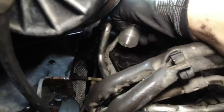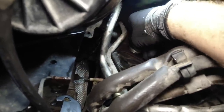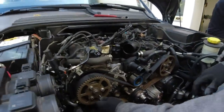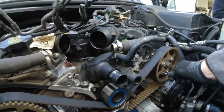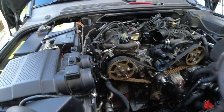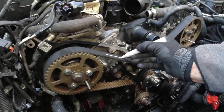This is a tool I made — it now fits nicely and locks the flywheel in place. Got the camshaft locked in position with this pin. I can still move the pin so it's nicely loose. Now what I've got to do is loosen the tensioner. We mark the belt for direction of rotation. I have the pin, and I have a new belt, so I would prefer to install a new belt.